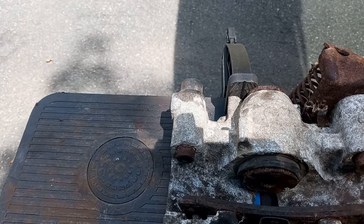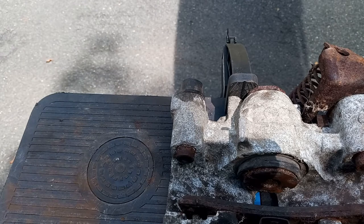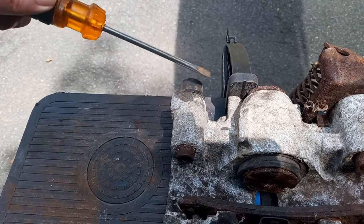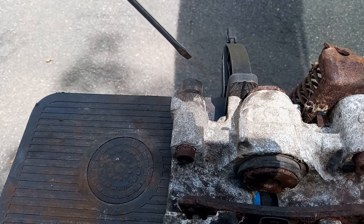This is the rear brake caliper. I wanted to give a specific example of a unit that's extremely corroded. I wanted to show an example of a brake caliper slide that's really corroded. So the first thing we're going to do is remove these dust boots. All I'm going to do is take this screwdriver, slide it in here, and gently prise around here to remove it. I'm going to do this off camera.